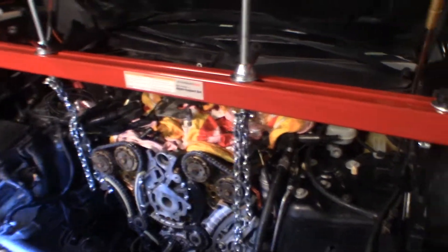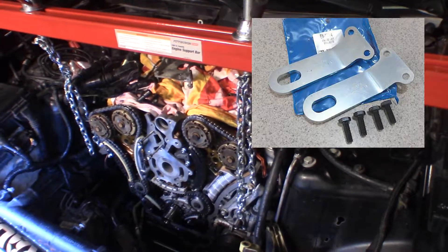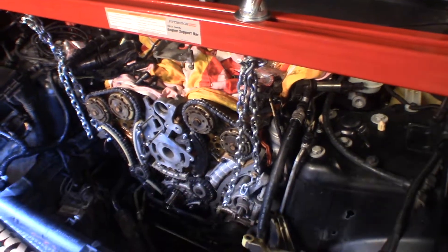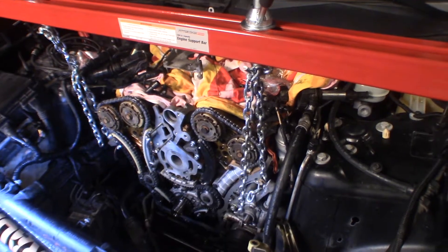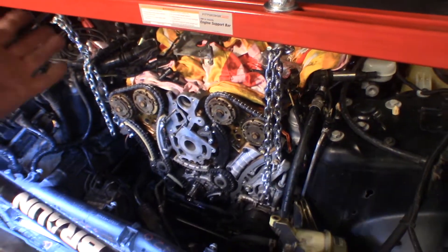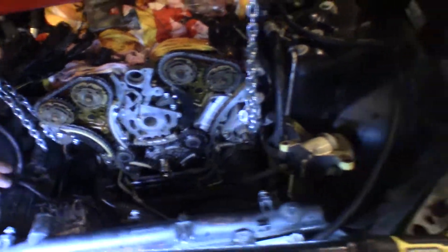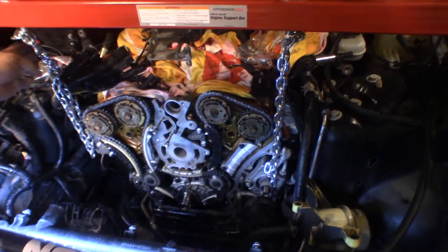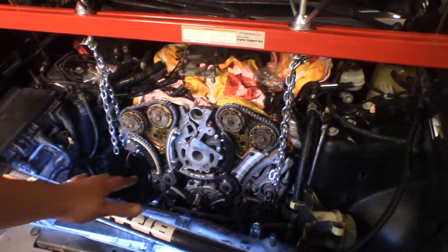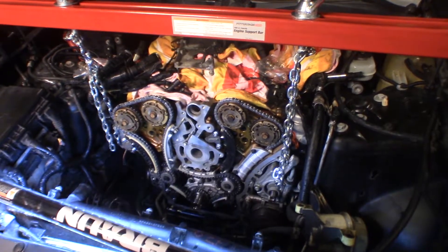These chains need to be bolted onto the side of the vehicle. These 3.6 cars actually have a bracket — I'll put the part number on the screen — and they hook onto the side of the motor on each side. Since I have my front cover off the car, I'm just using one of these front bolts that are for the cover, and that should be plenty strong to hold the motor up. The back of the motor is really being supported by the transmission, so it's just the front half. Everything's snugged down, and that'll allow us to unbolt the front motor mounts and drop the subframe to get the oil pan out.